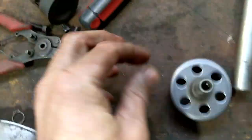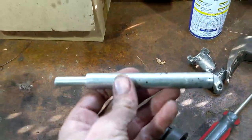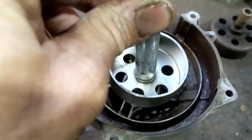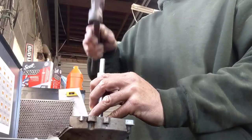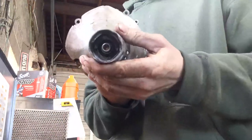So we're going to go ahead and continue with putting this back in. If you look on the new one, you can see that line there where your snap ring goes, in case you needed to know that. Basically what we're going to do is we're going to flip this upside down and we are going to set this back in there like so. I'm going to take this punch and put it right in the center of it — you don't want to put it on the sides because this is pretty thin and you can bend it. Go right into the center, make sure it's just covering the center and not hitting any of this part. Put it on the center and we're going to tap down. And there it is — make sure it's spinning freely. Now you can go ahead and put your snap ring back in, just like that.